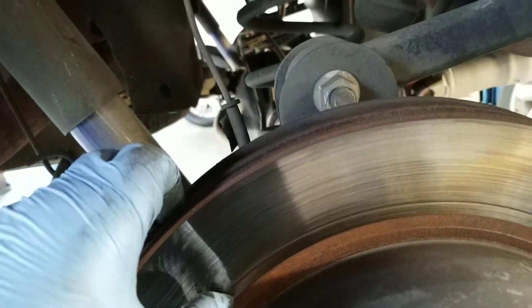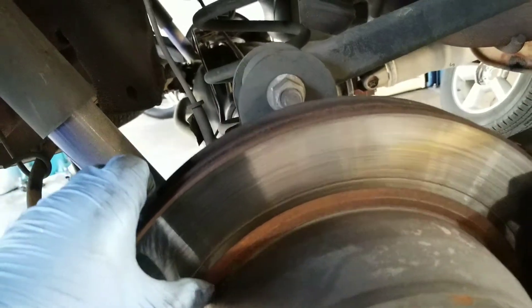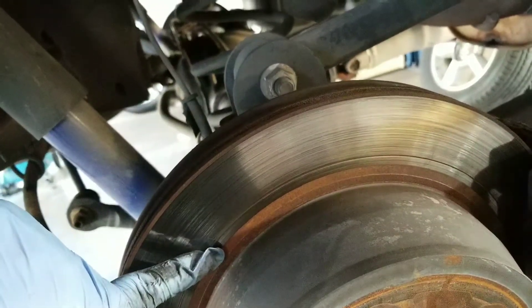although there is a lot of brake pad there, there is this deep groove in the rotor and just turning the rotors is not going to be good enough, because if I turn this rotor and put those same pads on, this exact same problem can come right back up.